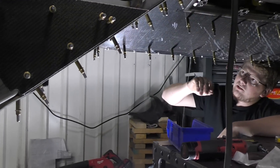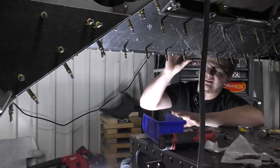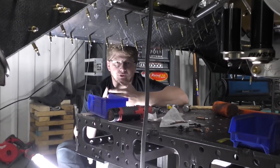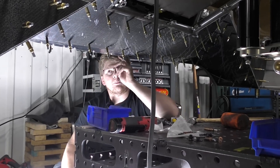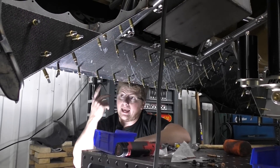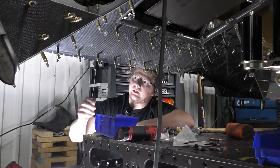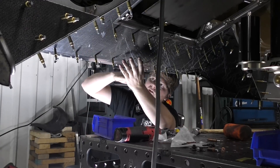Did something a little different. Since this is a stock bumper it creates a little bit more of a challenge because it's a little flimsy — it's all plastic. Any aftermarket stuff, like a composite bumper that's carbon or fiberglass, they're pretty rigid so they're a little easier. The stock plastic bumpers, like on a Fox or any Mustang newer from a Fox on, is plastic. So I ended up nut-serting the bumper on the very back and then wrapped my panel under the bumper.